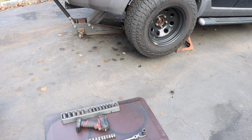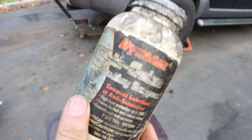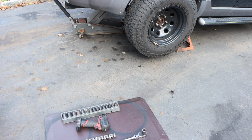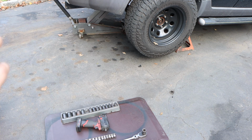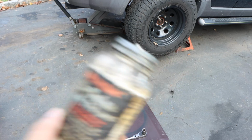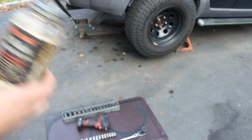Alright, so just a quick other note. Forgot. Anti-seize. Must. The gift and nectar of the gods. Right? This prevents rust and corrosion when we take the bolts out. We're going to put this on everything we take out, because the next time we do it, it'll be nice and easy, right? This is a routine maintenance item. You'll appreciate this the next time you have to do it.